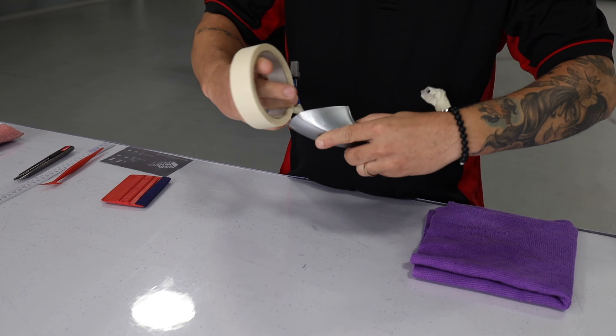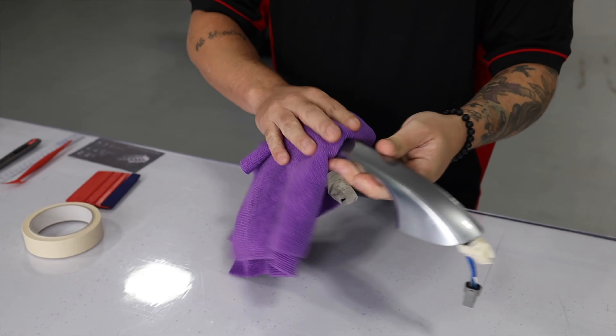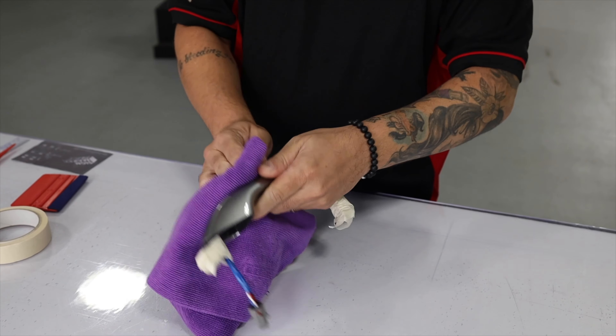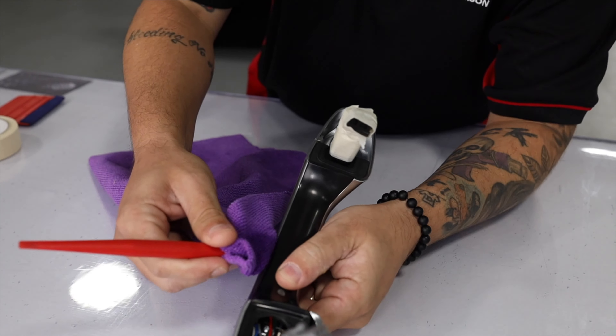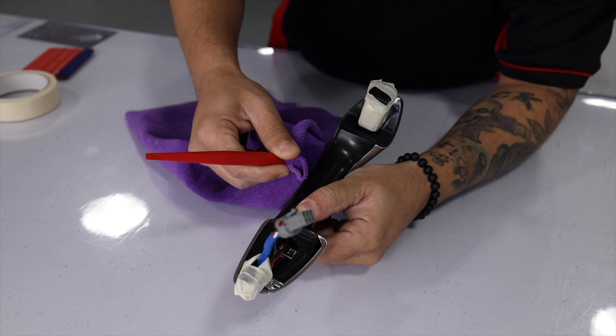At a work table, masking tape the base of the handle as a lot of grease builds up there, then clean the handle itself. Our vinyl sells great cleaners so be sure to use those, and also put extra focus on the edges. Take a tucking tool and a microfiber towel and dig into all the edges and on the underside of the door handle.